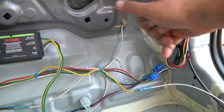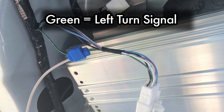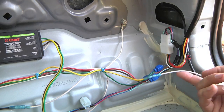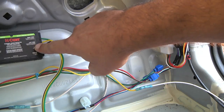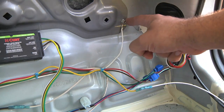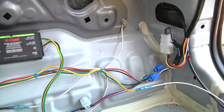That still leaves the left turn, which is over on the other side. Here's a still photo of that — it is a dark green wire. I had to connect onto it a wire that I ran across from that side back over to the right side. That's this white wire here that gets butt spliced in. This converter also requires a ground — this white wire — and I just grounded it right here to an existing screw.